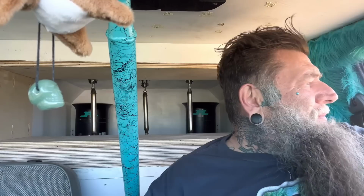I was using Down4Sound. And blue's positive and the white is negative. Usually your darker color is always negative. So he hooked them up like that. And then there was one wire we had to swap when we flipped the sub as the motor's in. And it was black and red, so he made red positive, so I put one sub out of phase.